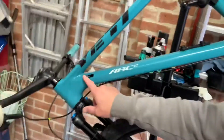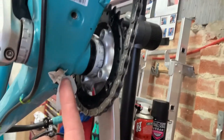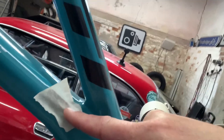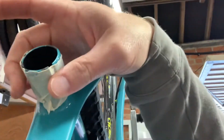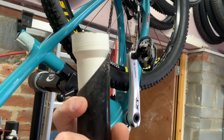I'm going to internally route it from here, down the tube and up here, and I'm going to use the vacuum cleaner and a piece of thread method using Mr. Henry. I've plugged up the down tube ports where the rear mech and front mech would normally have come out, and with a bit of masking tape I've also plugged up that port there, and on the seat tube I've put some masking tape around the compression slats just there. I'll put the hoover on this end so it makes a good seal over the tube — just a bit of plumbing because the slot on the end of the Henry won't seal very well.